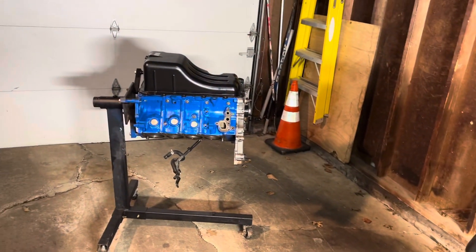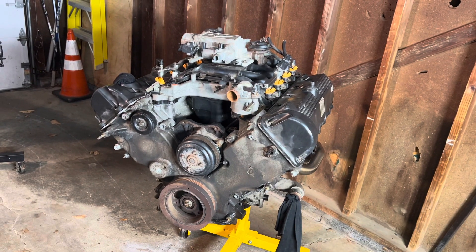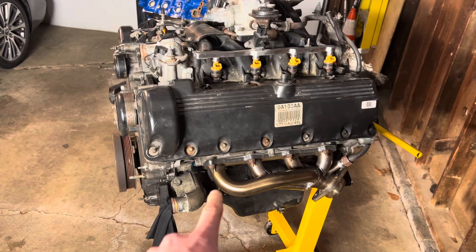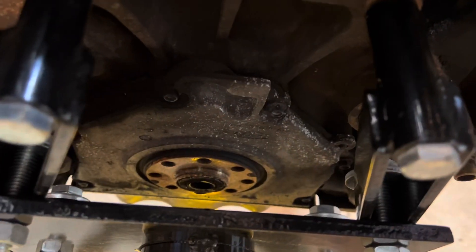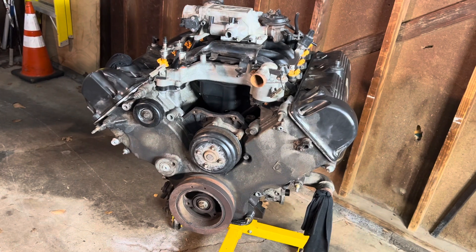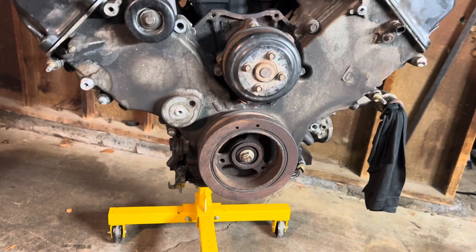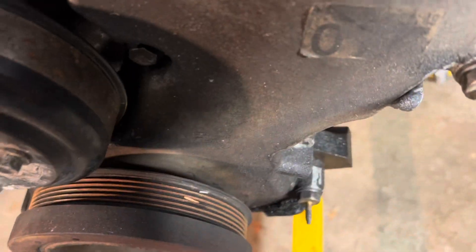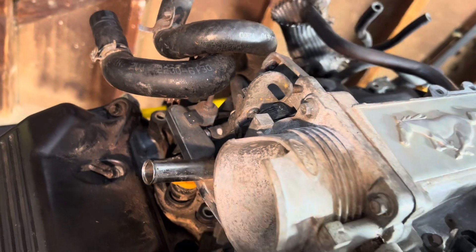As you could probably see in the background, I am building another 4.6 liter V8 engine for my Mustang, and I bought this engine basically to cannibalize because it had a few parts I needed. Upon first glance of the exterior, I think I did pretty well — I scored a set of shorty headers, a PI intake, PI heads, and the slightly more desirable eight bolt crankshaft. This engine is definitely slightly tired, as you can see from all of the carbon deposits on the outside. It's definitely been apart — bolts are missing, it seems like the crank was pulled off and slapped back on, and the intake plenum is chipped, so that's just scrap metal.